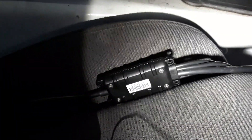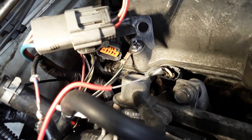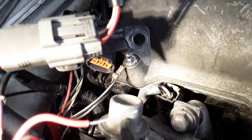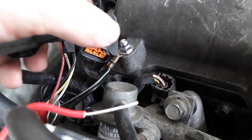You can see the blue-and-black wire attached to the red power wire for the LC-2. The black negative wire is currently being routed — there's a red wire that feeds up and through the actual firewall, and it will be grounded right there on the cam cover. The red wire is there stripped, and it will be going right underneath here for our negative terminal.